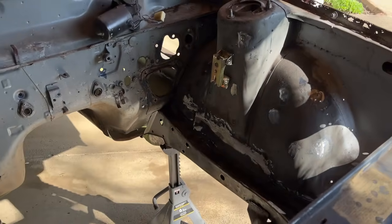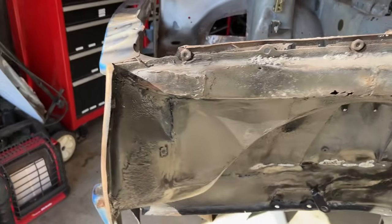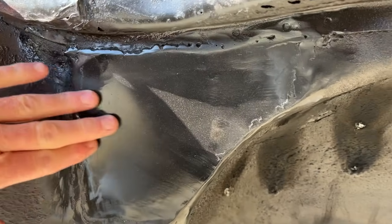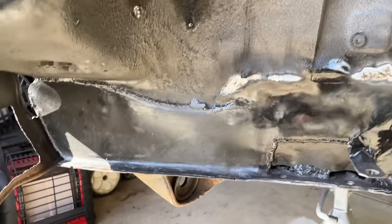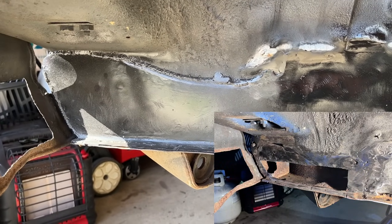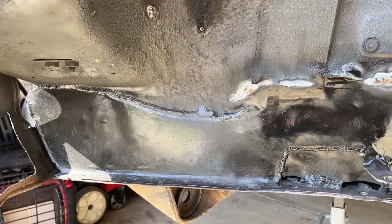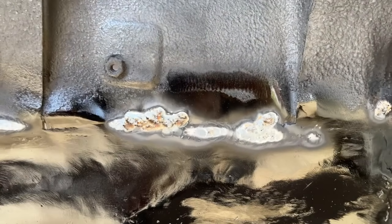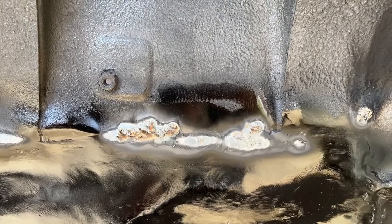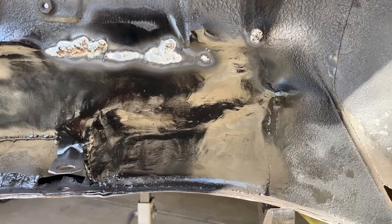I still have to put that lower piece of metal on the frame rail below to hold the floor pan in - it's ready to go, just not in the car yet. A lot of rust, but I think we're getting closer every day. I like that piece - it's nice and smooth and it's going to be covered with undercoating, so that'll work. The inside of this side is just as bad as the other side. I did a combination of plug welds and edge welds - the welds don't look great aesthetically but the penetration was really good. This side is all patched up and ready to go.